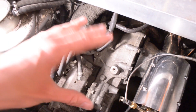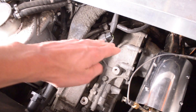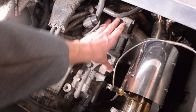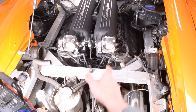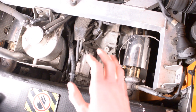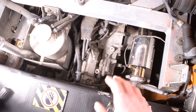This transmission is very interesting. It's colloquially known as a transaxle, meaning that there's the transmission in it and there's also the axle. You have a six-speed manual transmission, and then in this housing right behind here, you have a differential — in this case, it's a limited slip differential. Believe it or not, the Lamborghini Gallardo is actually all-wheel drive. They do that by moving the motor to the left just a little bit, which allows for a shaft to actually run all the way to the front of the motor to a front drive shaft that goes to the front differential. So this is a pretty complicated transmission, but honestly it's inherently the same as what you would find in just a normal six-speed manual that you'd find in an Audi or anything like that — just a little bit of a different design.